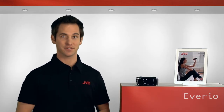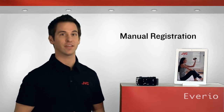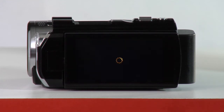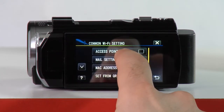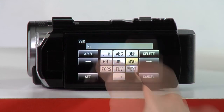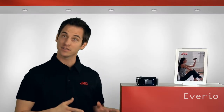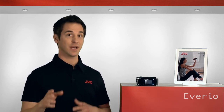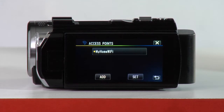The third way to connect to your access point is to enter the name and security settings manually. This is useful when your access point isn't broadcasting its SSID. To begin, tap Menu and then the Wi-Fi icon. Scroll to the right and select Common Wi-Fi Settings. Then tap Access Points, Add, and then Manual. In the space that appears, type in the name of the wireless network you wish to access, then tap Set. Next, select the type of security used by the wireless router. If you're unsure, it's okay to try them one at a time. For any of the options besides None, you'll need to enter the password for the network and tap Set. Once the registration is complete, tap OK and you're done.